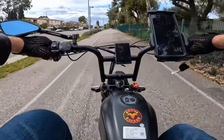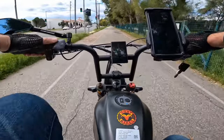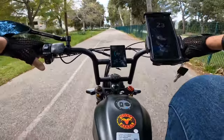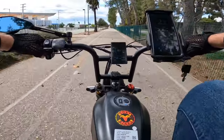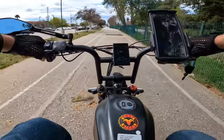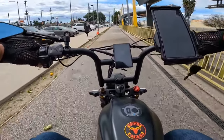Let me see how the pedaling feels — I didn't really pedal it. Nice — the pedaling is good! But at 45 mph it's going too fast, so I get ghost pedaling. I switched to pedal assist level two. I'm on three levels right now. Actually I can go to one but one is too slow — number two is good. I'd imagine 25 miles on one battery — about one amp per mile. I can tell you the charge drops dramatically after 50%. The battery is large so it doesn't calculate correctly. On other bikes I've noticed voltage-based percentage showed 37% but the battery died — so it's inaccurate. Now it's 15%.